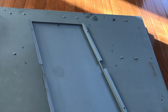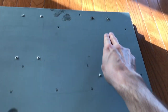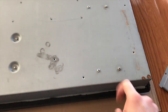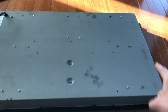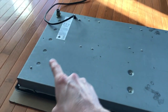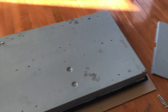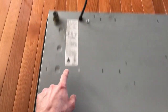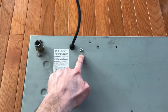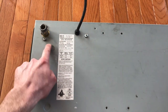All four screws are removed. This is just a plate — we'll set that aside in a safe location. The purpose of removing that plate is to gain access to five additional screws which will allow us to pull this entire panel off. Making progress — we've removed 16 screws plus the additional four. Not all screws are the same, so take mental note or take a photo so when it comes time to reinstall, you put the correct screws back in the correct holes.